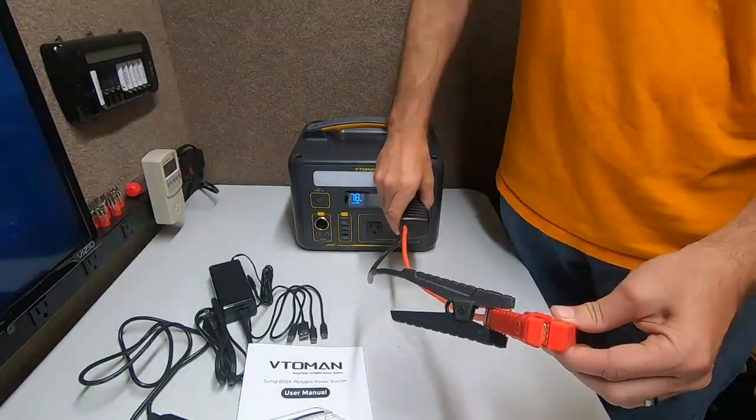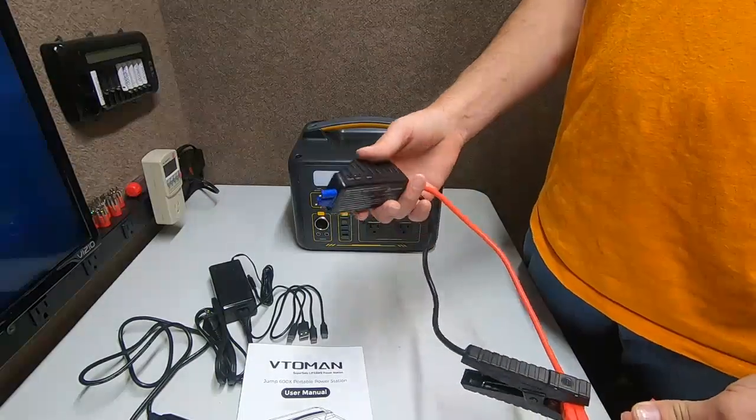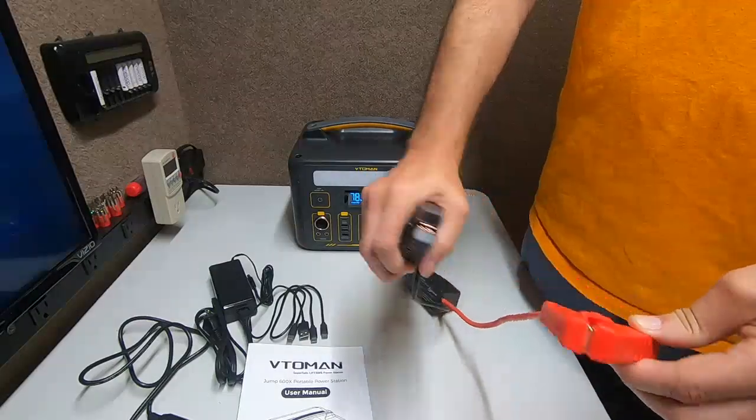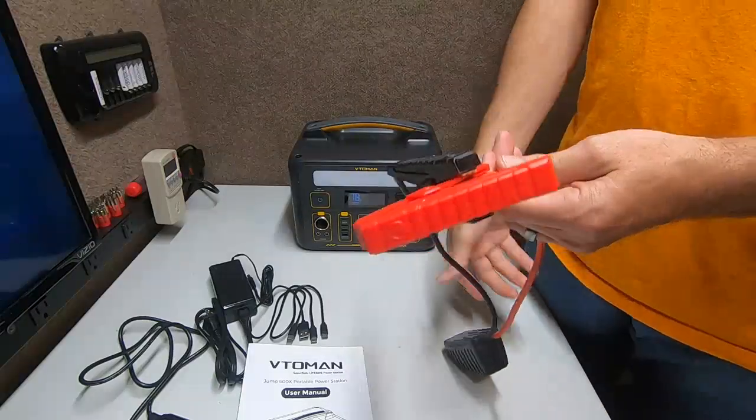Now we're going to unplug it because, like I said, you don't want to monkey with this stuff in the house. And then there's probably leftover energy now in that capacitor from being plugged in. So what I like to do is leave these guys alone and leave them like this for a little while, just so it burns up that extra energy out of that capacitor.